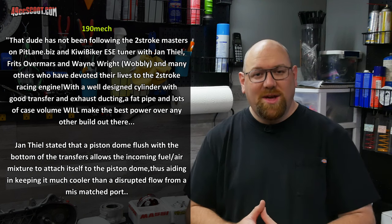I think that the Malossi setup is probably not ideal the way it is. However, I've seen people with shops that build a bunch of these and people that have dynos, and they're putting these things together with very minimal port matching at best. Some of them didn't appear that they even touched the cases to do any port matching. So I have to imagine they're probably not bothering to check bottom dead center and all that. They probably just do the squish check and move along. And it's not like these things aren't still wheelie monsters and making tons of horsepower. So I think it's all right, ideal or not.